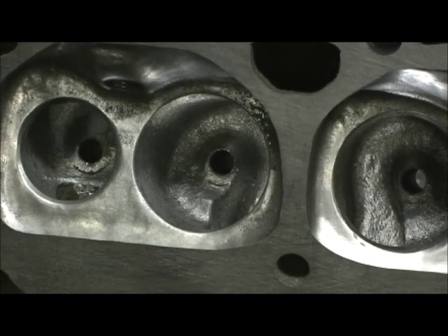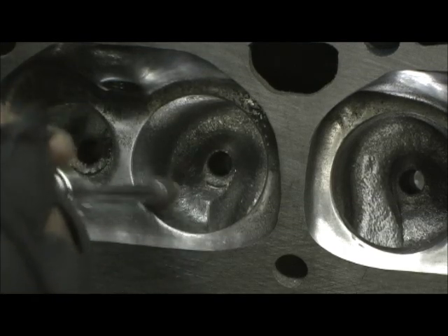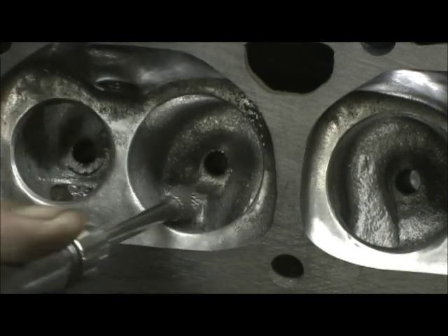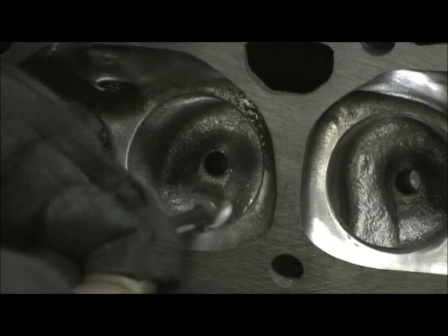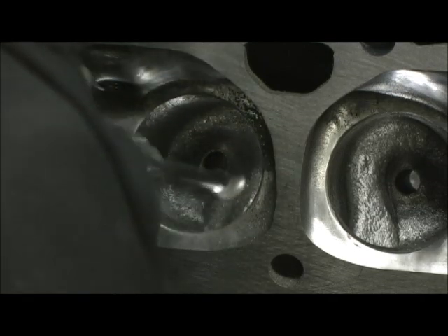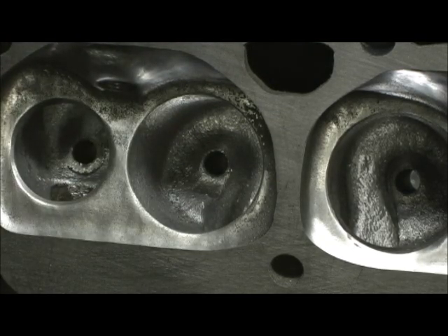Back on these incredibly, incredibly time-consuming bowls. I thought I'd show you something. When you're going in here on this area and you're doing the blending from the rough, the one thing you want to do is contour this wing. I want to get any mark of casting off — that levels it right here. There's no quick way to do this. What we got to do is form a radius on the end of that tit. I believe this could entirely have a lot to do with wet flow distribution, so spend a little bit of time gnawing on it. Then you just pull back and forth — there's the straight wall side, there's the curvature — and you just go back and forth and roll it. On the short turn on this, be very careful because you're in a thin area right there.